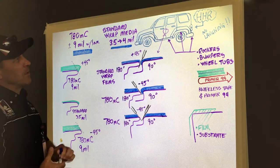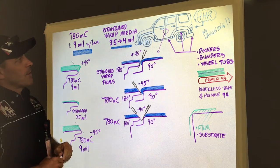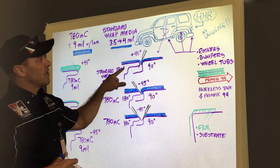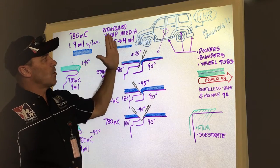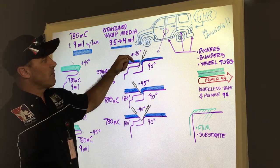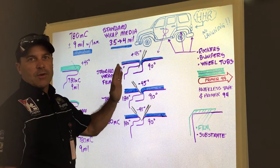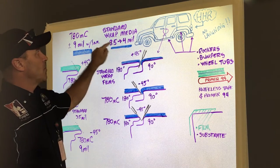Historically, when we've been talking about cutting and finishing things like jams, rocker panels, wheel tubs and things like that, we've followed a rule of thumb that we may want to alter slightly when we're using the 780MC film. Historically, especially in the color change realm, we've taught that on the 180-degree side — which is usually the trailing edge of a door — you want to hold your knife blade at a positive 45-degree angle when you come down that jam to make that cut. That leaves just enough film to cover the turn on the 180, so when you're looking at that 180 from the downstream side, you get full paint coverage. With a digitally or screen printed graphic, cutting at 90 degrees on that 180 side is probably acceptable, but you're still somewhere in the 3.5 to 4 mil range.